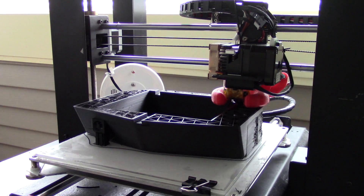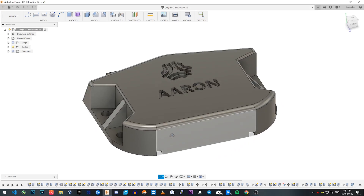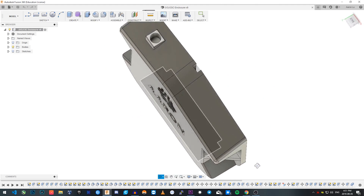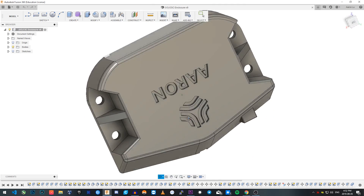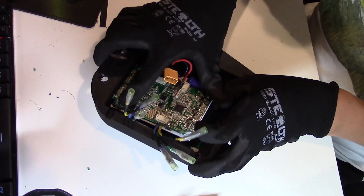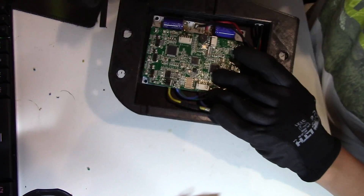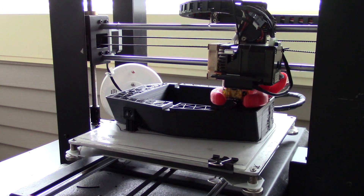I originally used enclosures from the Meeboard V2 because they were the cheapest, and they worked great for the period I used them. In June I decided to completely remodel the enclosure design, and after three iterations I concluded on this sleeker design based on the Boosted Board enclosure — 3D printed in PETG at 0.25mm layer height and 20% infill. The battery enclosure remained the same as it works well, but scratches easily on rocks or sidewalks. I also added velcro and multiple layers of foam tape inside to keep the battery from rattling.